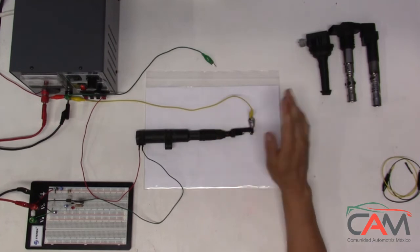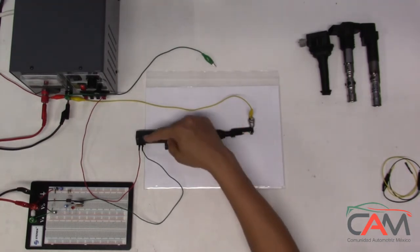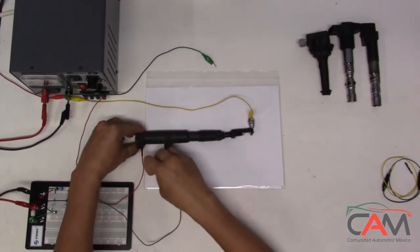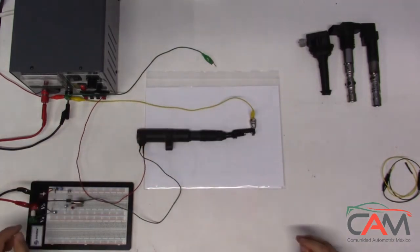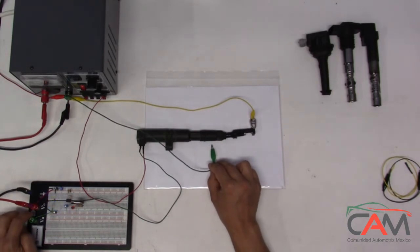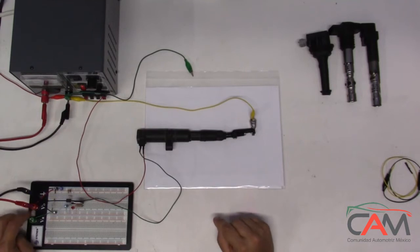When passing the ground cable over the boot area, the spark stops jumping to the tester and only jumps to the cable — meaning the rubber boot is open and we have a voltage leak. Installed in the vehicle, this coil would leak voltage directly to the cylinder head. The cylinder may work fine at idle, but when engine power is demanded the required voltage increases and that cylinder will misfire, generating cylinder misfire faults under light or heavy load.